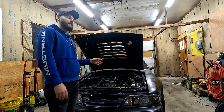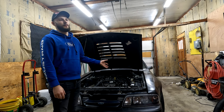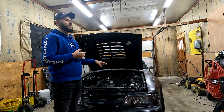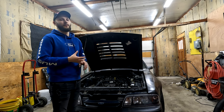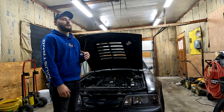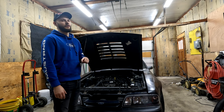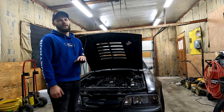Installing that remedied the high pressure fuel pump issue, but we've been working through some other hiccups. This car is missing the body control module that would be in a Focus ST — that body control module is responsible for quite a few important inputs to the ECU, the two most important being vehicle speed and clutch position. They're used by the tune to access different fueling tables and to control the engine. I've had to work around it in the tune. Luckily I've been working with Alan over at Edge Autosport — he's been great throughout this whole process. We figured out which tables and sensor inputs need to be turned off. Specifically, there's an entry for the ECU to detect if the car is in neutral, which is based off the clutch switch. It doesn't have that, so it always thought it was in neutral and would not go into boost or make any power. Once we got that figured out, we started moving along with the tuning.